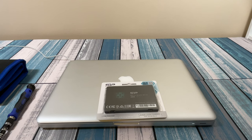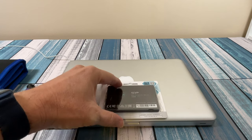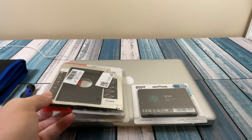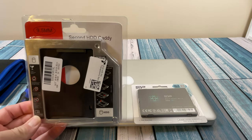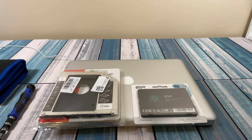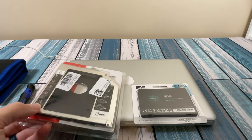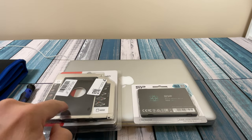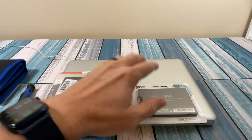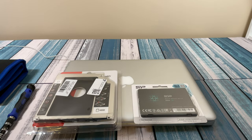That looks exactly like the hard drive from Part 1, and you're right - I got two of these. They were a really good deal, so I picked up two of them. And to go along with it, I picked up this guy, which is a second HDD caddy. They used to be called Data Doubler - the company OWC, or Otherworld Computing, makes a lot of really nice high-quality Mac upgrades. This is just a knock-off, but it basically allows you to put a second hard drive in place of the optical drive, since nobody uses CD or DVD drives anymore. So we're going to take this drive and put it in place, which will essentially double our data.